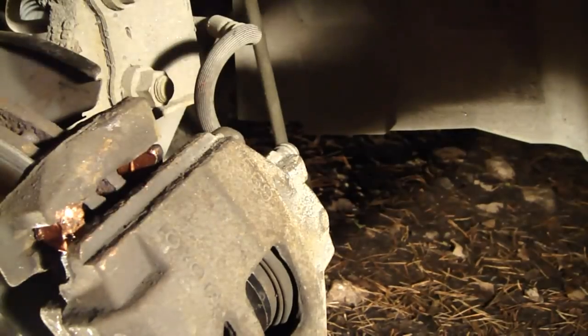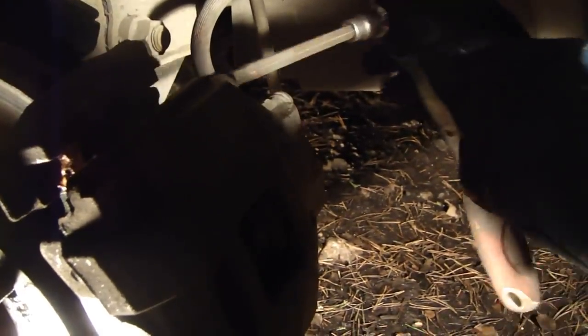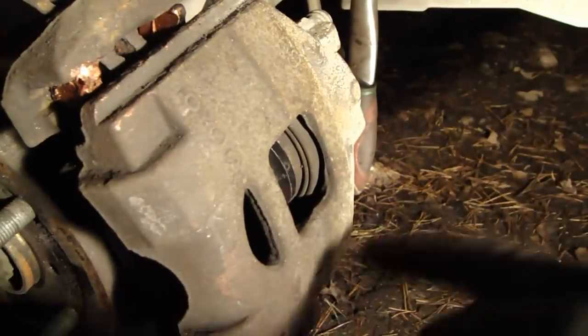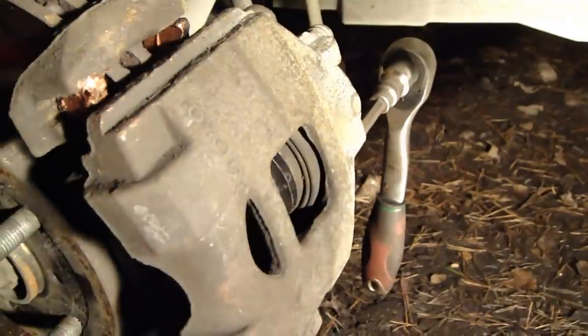And then I took this wrench so that I can fasten and tighten these bolts harder. Remember not to use too much force, because these bolts were something like 20 Newton meters if we use this torque wrench tool. 20 or 30 Newton meters. This small wrench is good, and one hand tightening. Okay, now the down area is fine, and then the upper area.